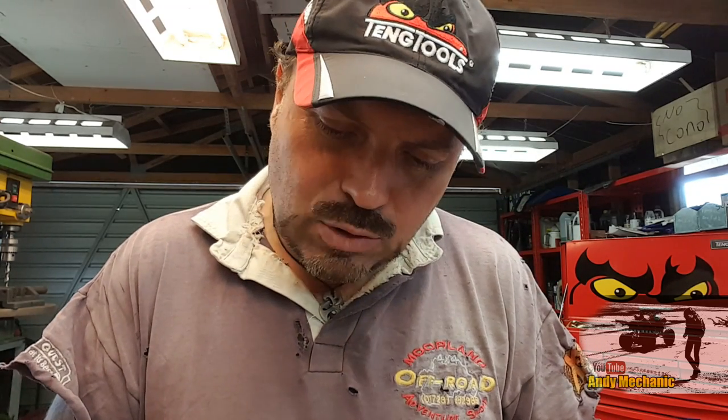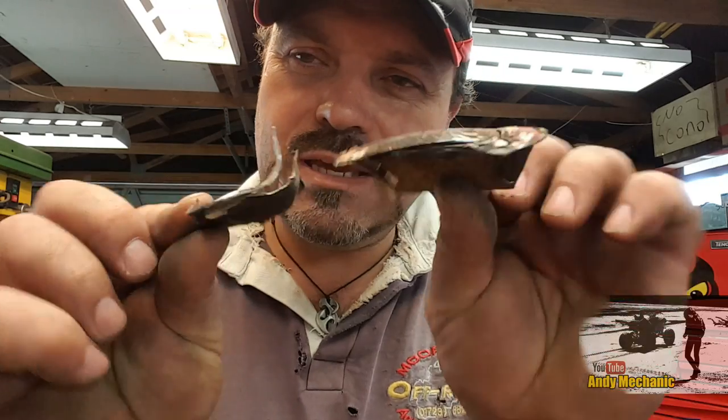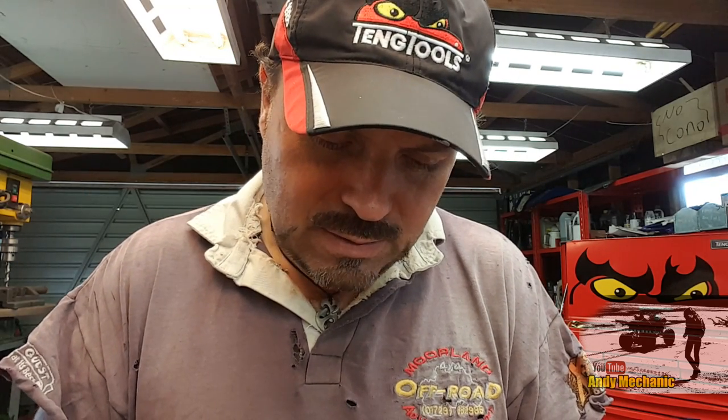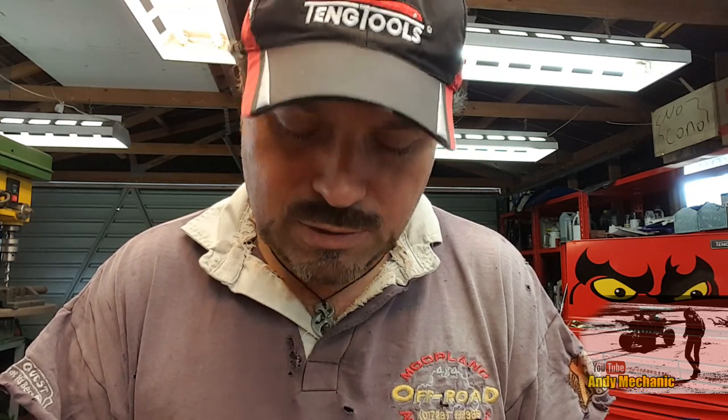And looking at the old bits that came out, these are the two bits that essentially we've removed. It's not really, really bad. I have a sneaky suspicion that the reason why it was leaking was down to those stress cracks, as opposed to actual corrosion holes, which is great news for the rest of the fuel tank, because it means that there's probably still a bit of metal left, which that sealant hopefully will preserve for a few more years, and then God knows what it'll do.